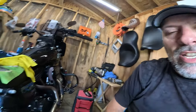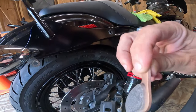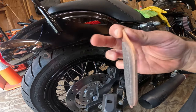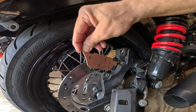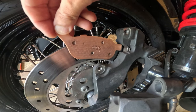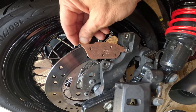This is going to be fun — summer just started and the GoPro is already overheating sitting in the shed. Here are the new brake pads. You want to make sure you get no grease on this — always keep your hands clean, nothing on there. When you put this together, that tab is going to sit inside that little clip right there. One on one side, one on the other side — that's how it's going to sit in there.